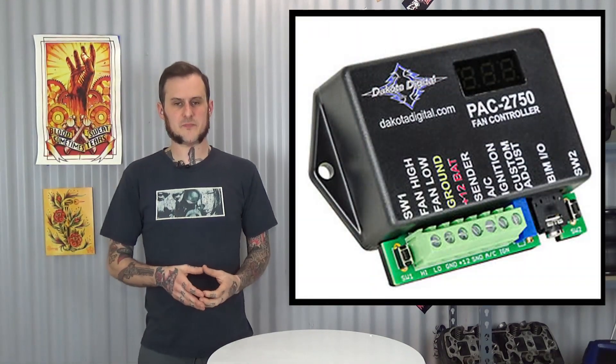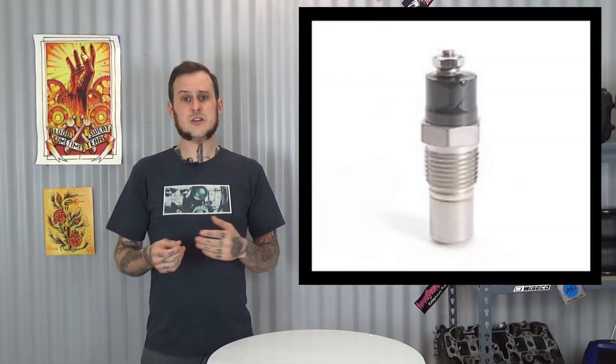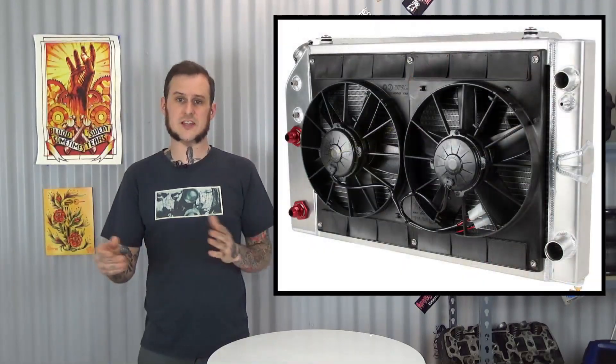Next let's talk about the Dakota Digital system. I really like the Dakota Digital setup. Like the Centec, it can pick up off your existing sender unit so you don't have to add another sender if you're running electric senders. If you're running a Dakota Digital system, one of their VHX gauges or the digital gauges, you can piggyback off of the existing control box and it'll send the signal to the new controller so it's got its temperature right there. The Dakota Digital is nice in that it can independently control two fans to come on at different temperatures or the same temperature, and you can control that high and low setting at whatever temperatures you're trying to set it to. You can also control hysteresis with the Dakota Digital system, which is the amount of time it'll stay off. So if your engine is right at a temperature where it's going to kick that fan on and off pretty often, the hysteresis allows it so you're not having that fan cycle too much — it'll wait, say, 15 seconds before that fan can come back on, which is nice to keep the fan living a happy, long life.